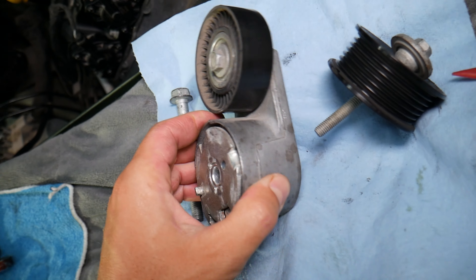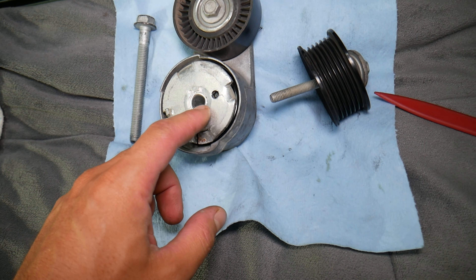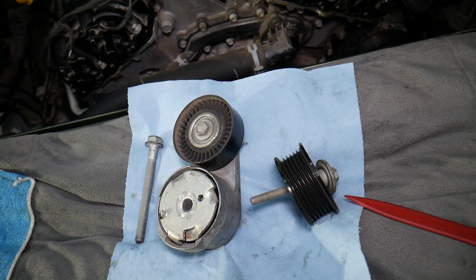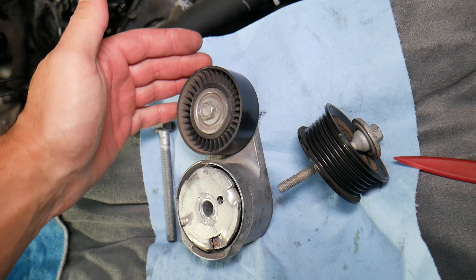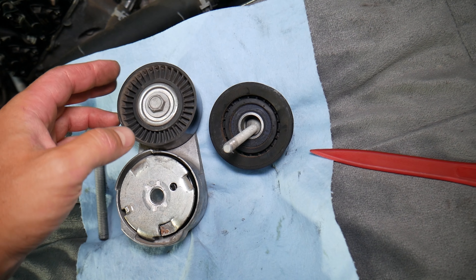What can cause the belt to fall off? The most common thing we see here is the tensioner failing. It has an automatic spring, and if that tensioner fails it will not put tension on the belt and it can come off. Number two: failing pulleys on the tensioner. Those plastic pulleys do fail eventually and the bearings can fail as well.